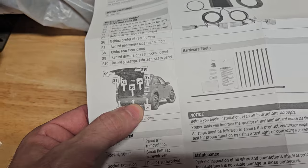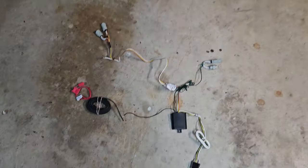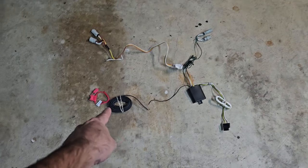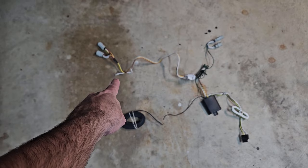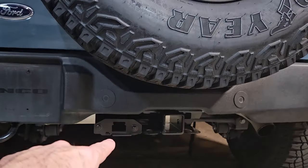The kit comes with pretty good instructions. I saw this and was like 'oh no, that's the wrong kind of Bronco' but then the right Bronco is actually in there, so we're good. The layout is: the left adapter goes into the driver's side light, the right one goes into the passenger light, the actual wire goes to the front where the battery is as a constant, it has a ground that goes to the vehicle ground, and this comes right back out and hopefully fits right in there.